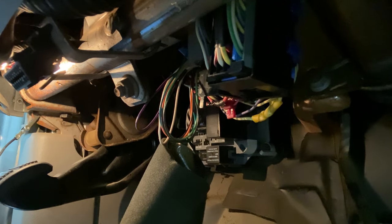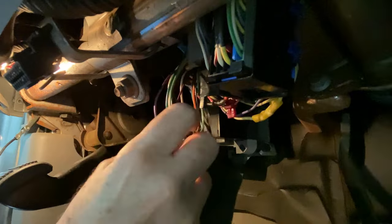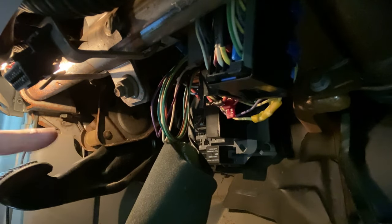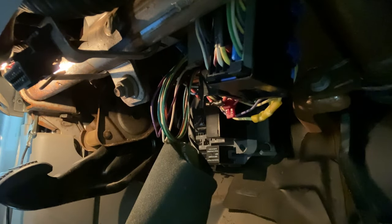If you're looking and having trouble finding the correct wire for your TCC, that's where it is — even on the earlier years. On pre-ABS vehicles you may have to check the wire color, but the method is the same: trace and pull the wires from the switch at the top of the brake pedal, probe those wires with the key in the on position — not run — ground your test light, and when you find one that has power and goes out when you press the brake pedal, you've found the right wire. That's it for today — thanks for watching, I appreciate a thumbs up and subscribe, and we'll catch you in the next video.